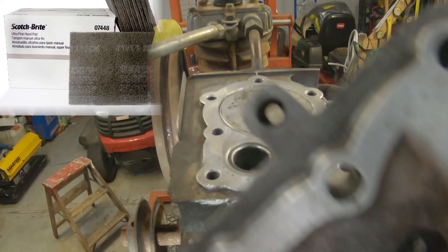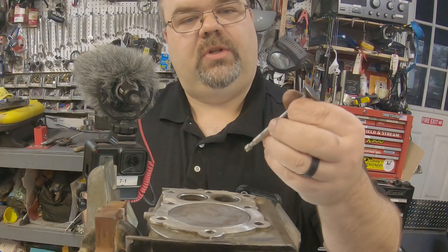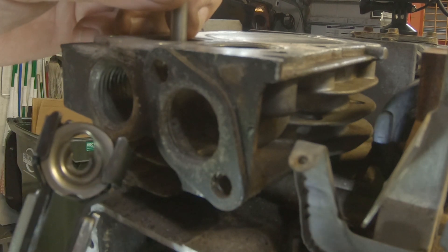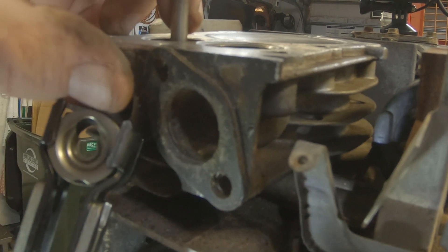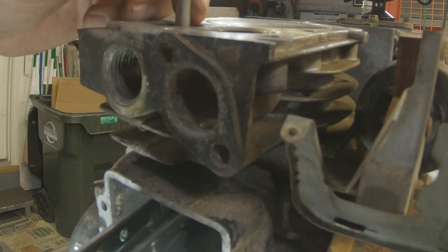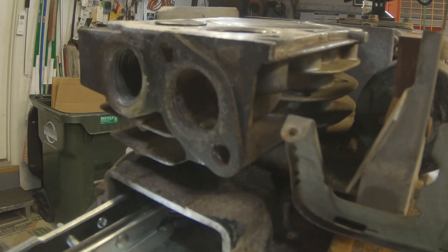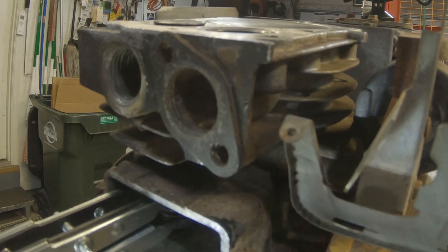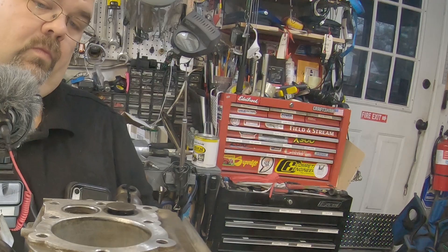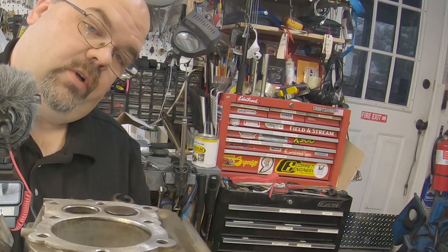Got the block cleaned off, polished that head up a little bit, got that ready to go back on. Once you get your valves all cleaned up or replaced, put your keeper back in here — make sure it's on the bottom. I like to turn this so the hole is in the front. When you put this in there, drop it down over the little tappet at the bottom, put your spring down through it, pull that up and then push it back, and when you release this it should be on that valve. Just pull your tool out, get that on there correctly, and that valve will work the way it's supposed to.